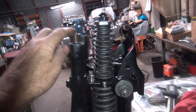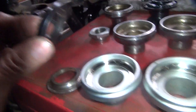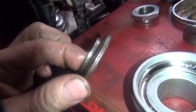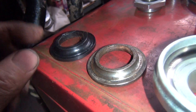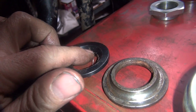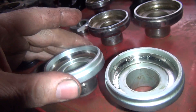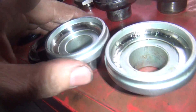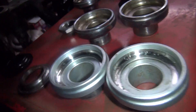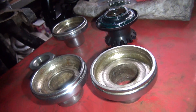So you just stick off ninety thousandths more off the top of this — that's where your nut here just lost more thread. When you put this bearing race inside of my stock cup and compare it to the stock bearing race, you got ten thou difference. So you gain ten thou here that you lose on this side, and on the other side here you lost about fifteen or twenty. So that's thirty thousandths you lost for sure right there. Then the cup, you lost another forty-five thou or so, and then the stem, you lost a hundred. So the numbers are starting to add up — you add these two together and now you get a hundred and thirty, forty thou you're losing right there. And it just keeps multiplying.